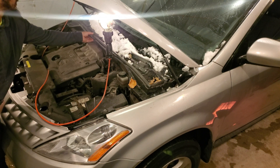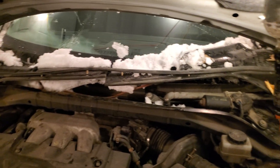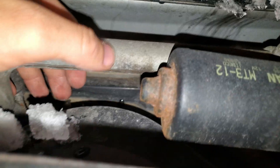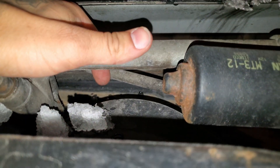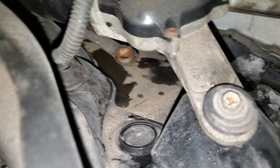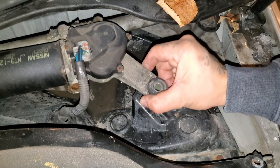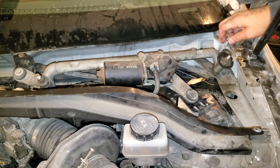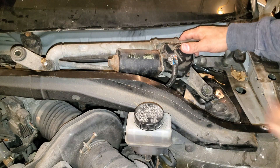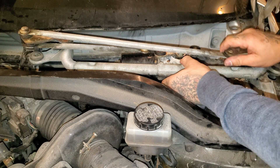Now we're going to go ahead and just take this thing up. We don't need to fully remove it — we just need access to this area right here. The bushing has gone bad on the arm of the motor. There's an arm that goes right underneath and you can see this thing is disconnected — it's supposed to be attached via a bushing. So now we take our 10 mil socket and once that mechanism is free, we take the other two bolts off as well. Once all three bolts are removed, you can take the whole mechanism and flip it upside down to see what actually happened.